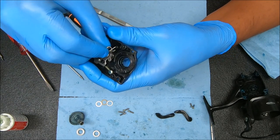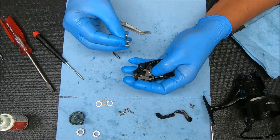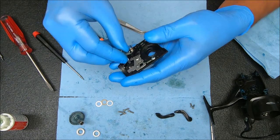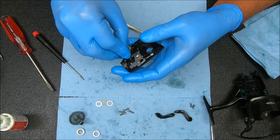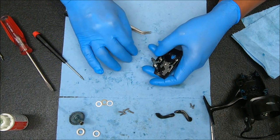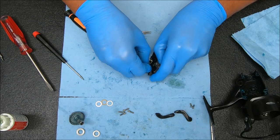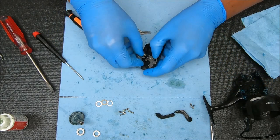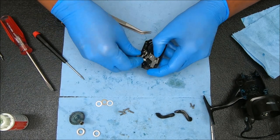Now all we're going to do is take this inside the hole. But before we do that, I want to show you what the process will look like. You're going to have this inside the hole, engaging with that arm, turning like that to push the pawl down. So I stick that in, use both hands, rest this on the table, take my finger, push that forward, push down towards the hole on the bottom, as I rotate.